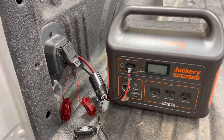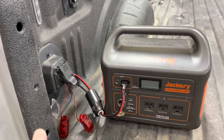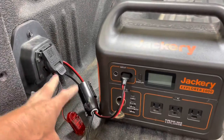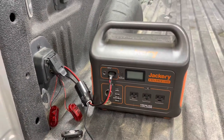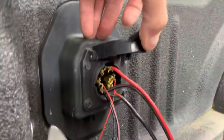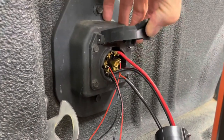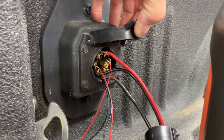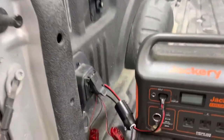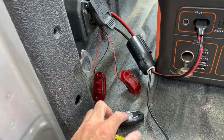Obviously I don't want to have all these lights hooked up all the time. I've got to figure out a way to cleanly set the system up so I can charge our Jackery portable power station without this goofy light setup everywhere. To recap: the truck needs to be running, you've got to push on the brake, and it needs to sense a trailer — which means it needs to see left and right turn signal lights, brake lights, and the brake controller output. But at least we proved the concept of how to get power out of the seven-way plug.